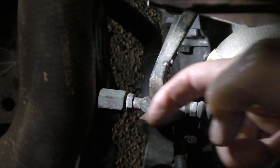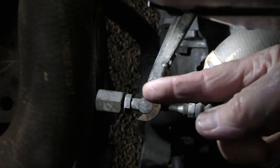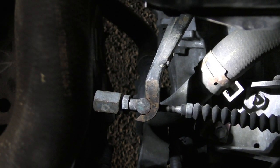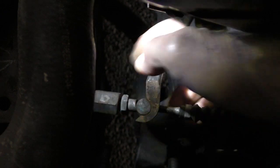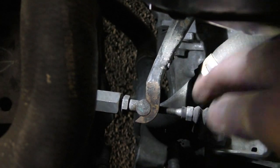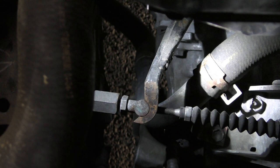What that allows me to do now is turn this nut, which effectively lengthens or shortens this cable. Now I need to lengthen it a little bit. So I'm going to turn this inner nut anti-clockwise, which means if the spanner is at the top, push it away from you. It's on like a cam, so when you turn it you get half a turn and then it locks back into place again. That has increased the amount of play on the pedal. I've just moved it one click and I'm going to go and check that to see whether that's giving me back my 15mm play.